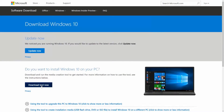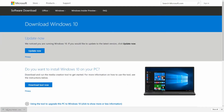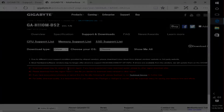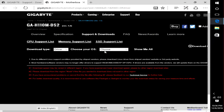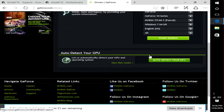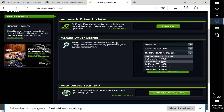Now go install Windows. If you're not sure how to install Windows, let me know in the comments below and I could do a tutorial. Install Windows and download the drivers from the motherboard site and the Nvidia website — do not use the ones found on the disk as they tend to be outdated by the time you buy the products. I'll leave links in the description to download Windows, the motherboard drivers, and the GPU drivers.